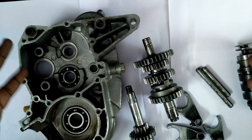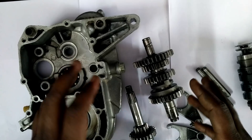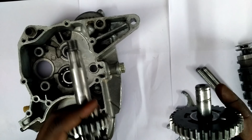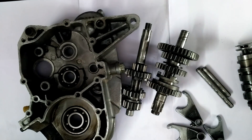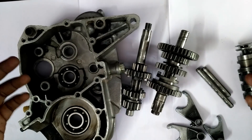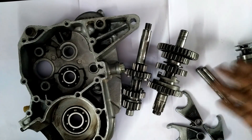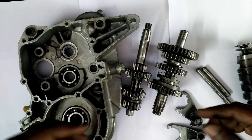What happens is those marks when spinning will cause a humming noise. To best define that noise — if you have ever heard Batman's Batmobile move, it makes that weird sound. That is the sound a gearbox will make if it's getting damaged. It is not going to be a catastrophic failure, but it's going to be a very bad irritation when you are driving. Just imagine you are doing 20-30 and the bike just starts screaming as if you are driving like a lunatic.